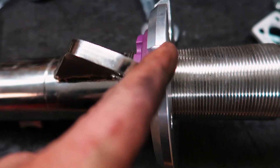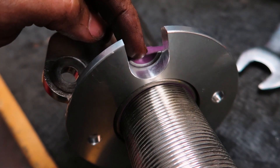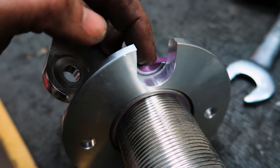There's the relief cut we did in the lower bag plate. We went ahead and marked out the lower spring perch where the air fitting needs to come through, so we have to do a little relief on the KW lower spring adjuster to allow the airline to pass through.